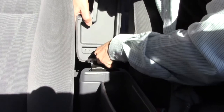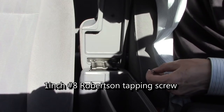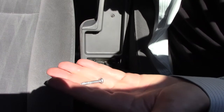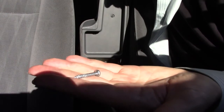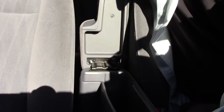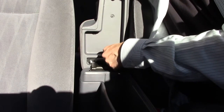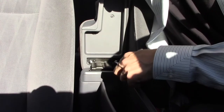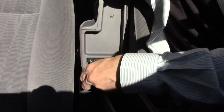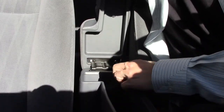Now reattach the armrest with the larger 1-inch Robertson machine screw — it's a number 8 if you're looking for the thread size, the same as the previous black screw that came with your Honda. Keep in mind you want to be turning these threads straight and slowly to match the pre-threaded deeper anchors. Just take your time, don't double-thread it — it should go in very easily.